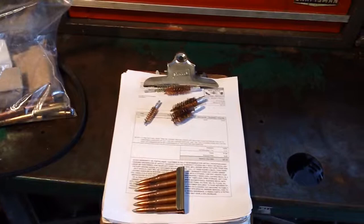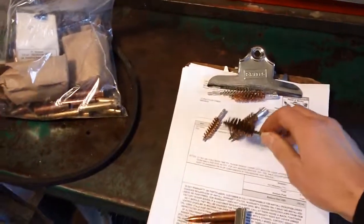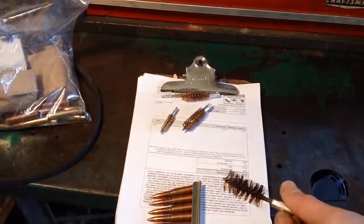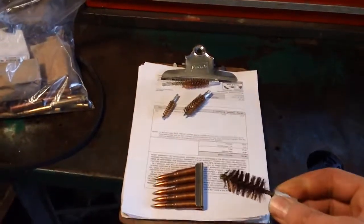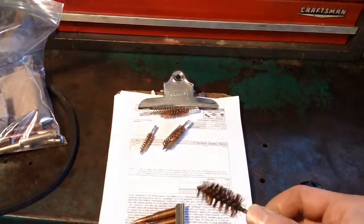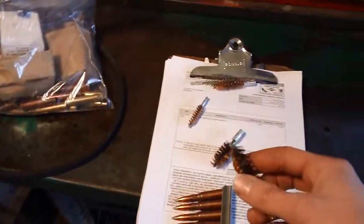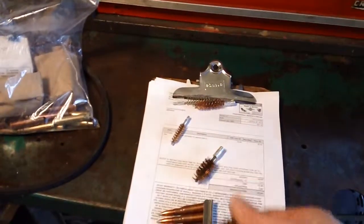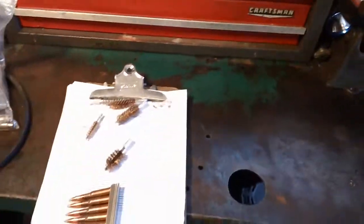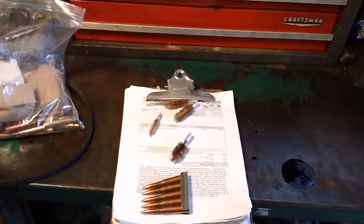Then the last step would be to spray one of these wire brushes with some Windex window cleaner, because most window cleaners have chemicals in there that clean windows relatively well, so they'll get off oil, dirt, debris, and stuff like that. Just take one of these brushes up there and spin it around about 30 or 40 times, and blow it out again with the air gun. Then get the brake cleaner and blow it out again with that. So that'll be the last resort for that.